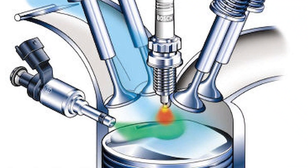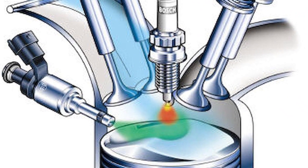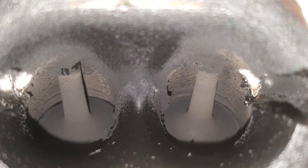This engine features direct injection, so the fuel is injected under very high pressure directly into the combustion chambers. It's good for fuel efficiency, but over time the intake valves get carbon buildup. This happens especially fast if you drive mainly in city traffic, and after 40 or 50 thousand miles your vehicle may need professional carbon cleaning. Using cheap spray cleaners is not a very good idea in this case, since they may damage the engine rather than clean it properly.